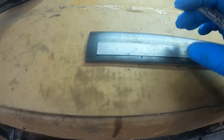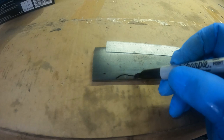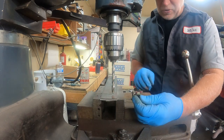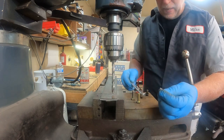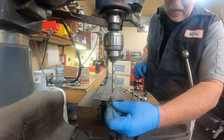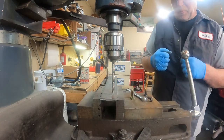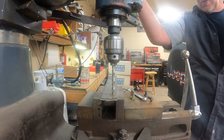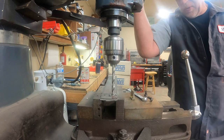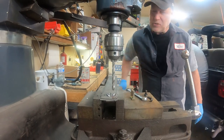I'm going to favor the holes to the bottom side because if you put them in the middle, you're going to have to cut out more material — I'll probably have to cut a little scallop out once I put the two holes in. The two bolts I took out for this tool to align to were half-inch head bolts with 5/16ths-18 thread pitch. If you run them through the tool and then through the pulley, you're not going to have a lot of engagement, so I went with approximately 3/8-inch longer bolts to go through both. The hole size I'm putting in is roughly 3/8ths — just a clearance hole. These can be easily hand-drilled. Don't fuss about it.